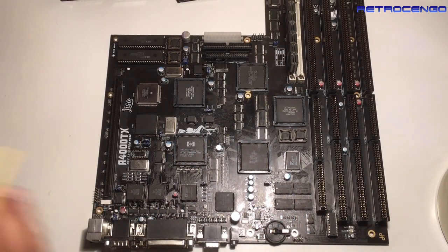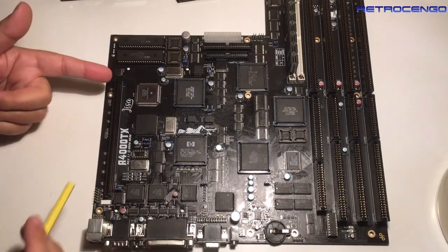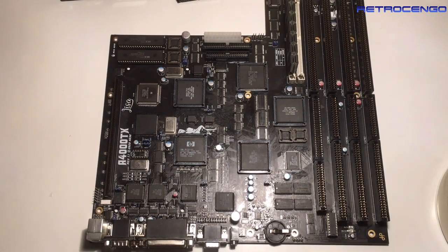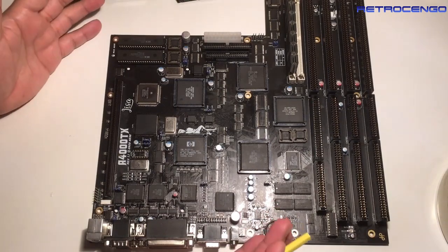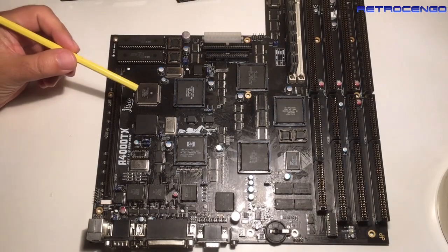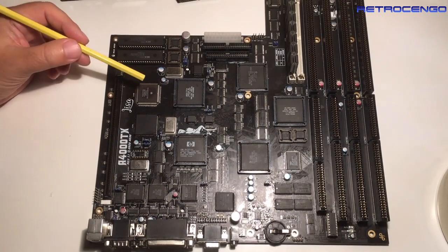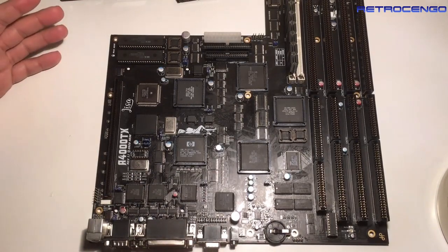The next thing, on the older revisions, you have this beautiful CPU socket over here, where you have to put in your old 030, 040, 060, whatever you want to boot your Amiga, okay? You just had to adjust the jumpers, but that's another story. But guys, on the revision D, over here, we have got an onboard Motorola 68030 running at 25 megahertz, CPU built in. So the revision D CR comes with CPU built in, chip RAM built in. So it's just from the get-go, you don't have to install anything, you can just boot it.